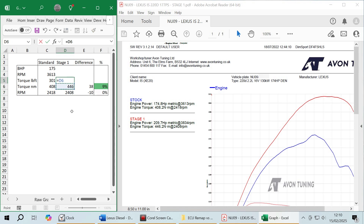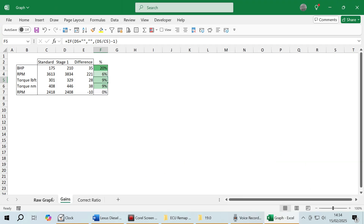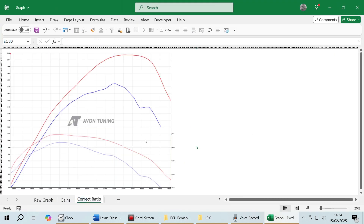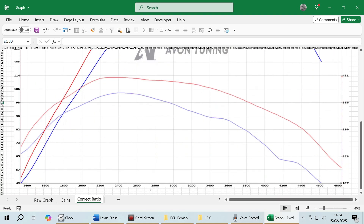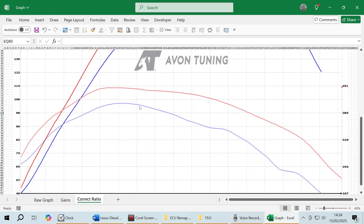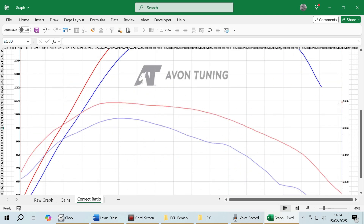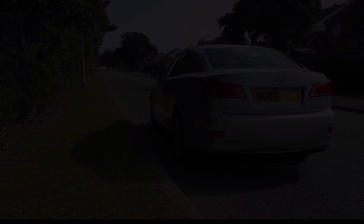This works out as an increase of 9% in torque, and because the torque curve is spread over more of the rev range, the brake horsepower increased by 20%. Bear in mind this was during a heatwave in July with outside air temperatures of 27-30 degrees during the remap. The engine now produces the same torque at 1,575rpm as it previously did at 1,800rpm — exactly what I asked Avon Tuning to do. Pulling away from a busy junction is now much more confident, and you can pull away at just above tick-over with reasonable force. These are very promising results, but what about the real world? Has the remap made the car more drivable across the rev range, especially at low RPM? Let's find out.